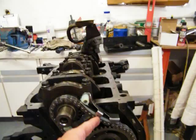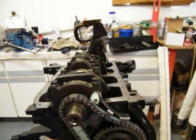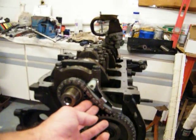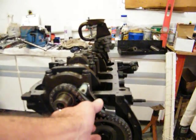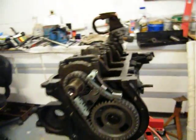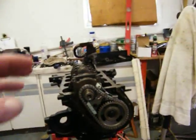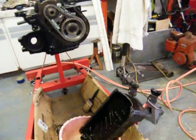It's all a learning process. I had to take the keeper out right here, then get a pair of pliers, put a pad on it, and squeeze them both together so the chain would go up and I could get it on my camshaft. But that's done, and now I need to torque it down.